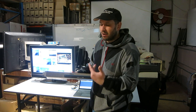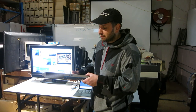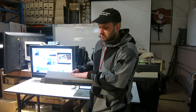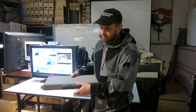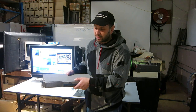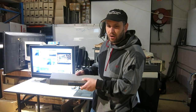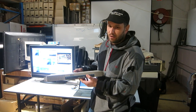They also supported their own usernames and passwords, and you could also do LDAP usernames and passwords. For a smaller business that didn't have the infrastructure, all you needed was this. You set up the usernames and passwords in there, connect it to a bunch of phone lines off your PABX or direct to the wall, give those telephone numbers to your guys on the road, and they could log in from home and access everything like they're sitting at the office.